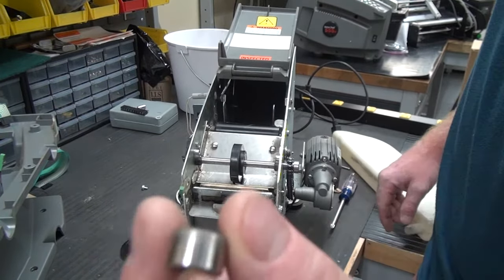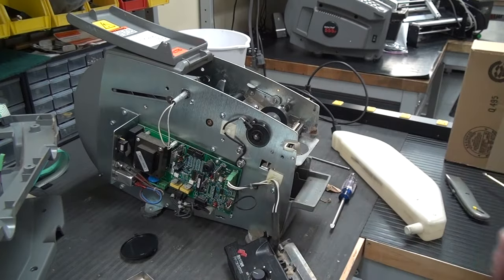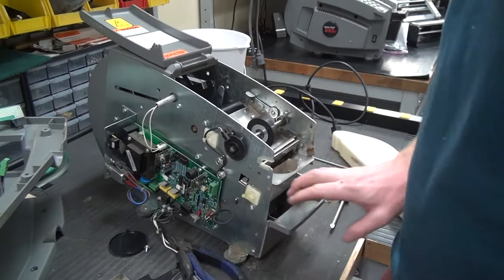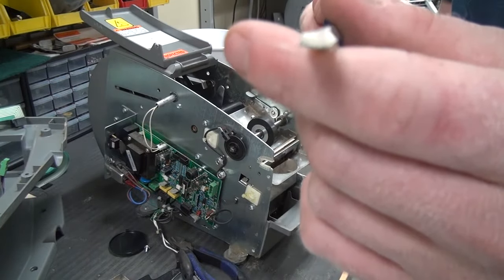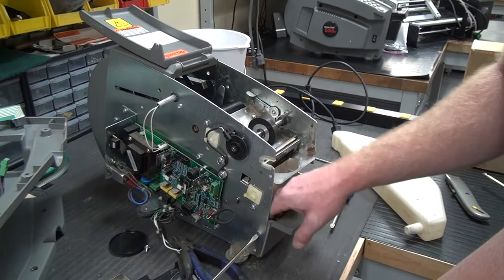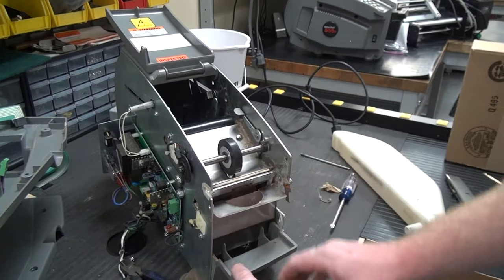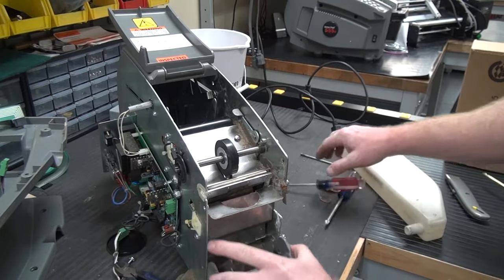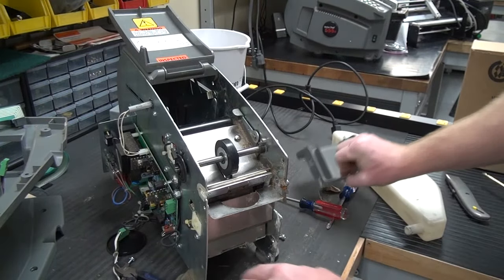Then you're able to pull this heater out — just take the front shaft and pull it out. One of these rollers goes on each side of the heater. I'm going to clip this little clip right here so I can actually take the heater off the machine. This lower plate is a trick: take a flat-head screwdriver and hit it flat into the hole, then aim for the forward side of the hole. While pushing it in, also pull it forward a little on the end, and you see how it pops out. Then you need to hold it forward because you've got to do the other side.